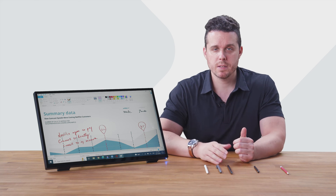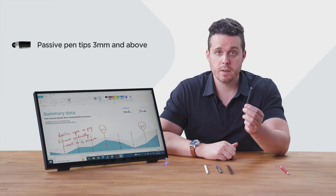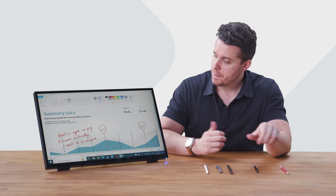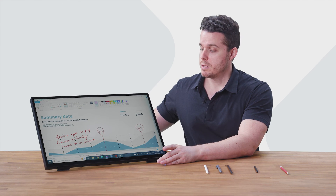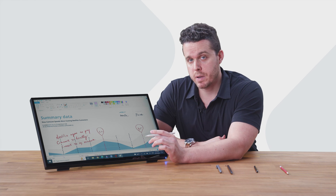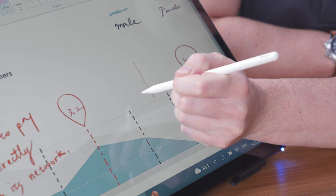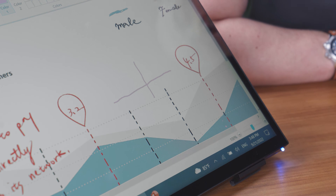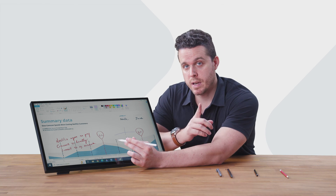Keep in mind that with active pens, it will not recognize pressure levels. In addition to those, you can also use a standard passive pen or even a pencil. The TD-2465 has a tilt angle of 15 to 70 degrees, so you can adjust it for your use case. It also has a palm rejection area of 25 by 25 millimeters. When you write, be sure to write smoothly and slowly, not too quick. Also, when in this mode, the screen will only recognize the pen signal and not a finger.